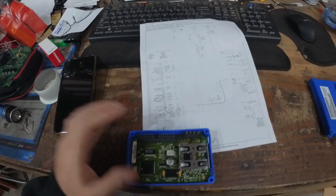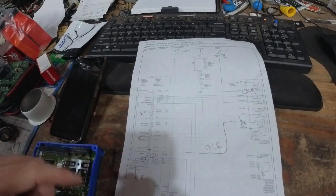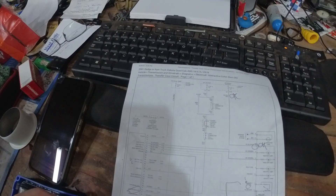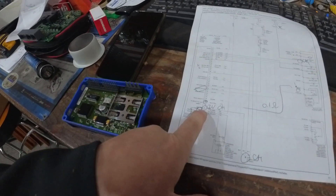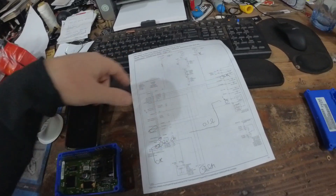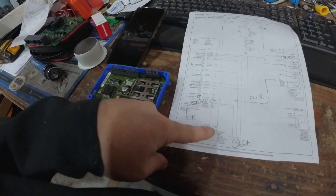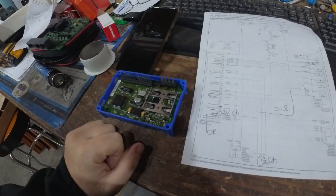So what we have to do here — first thing you do is powers and ground, immediately, that's the first thing. We go to connector A right here, continuity to ground — okay. Then B, we go to our fuse and check voltage at the fuse. If you have power there you're okay; if not you have to go backwards. We got power, we got ground, we know that for sure. Now we can measure continuity between these two here to make sure the motor is connected — that could be 100-something ohms or some other number.